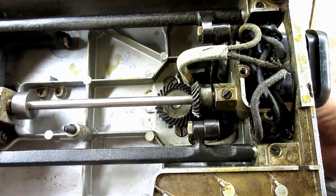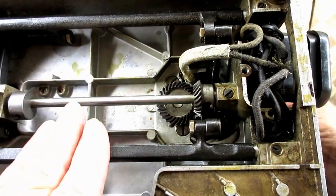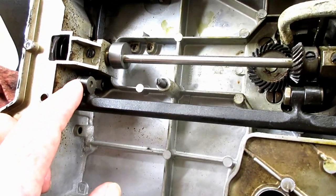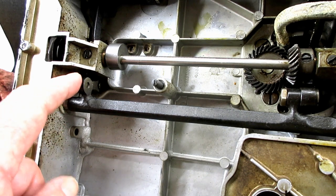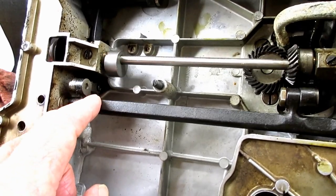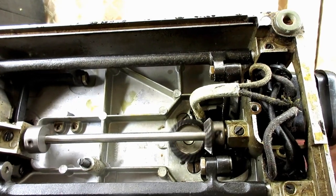And you can see it moving back and forth as I'm turning the hand wheel. It's kind of rocking like that. And over here on the end of it right there is the feed bar that goes up through just below the needle plate, and the feed dog is screwed into this feed bar. So this bar lifts it kind of like up and down, where this top bar makes the oscillating front to back or back to front movement. Okay,